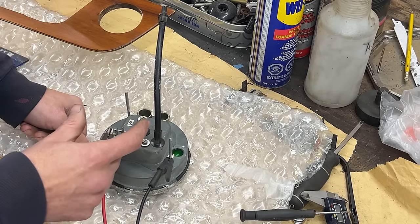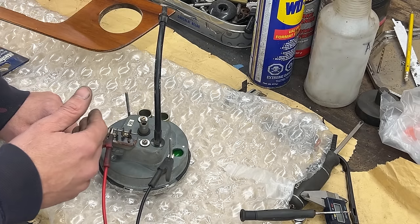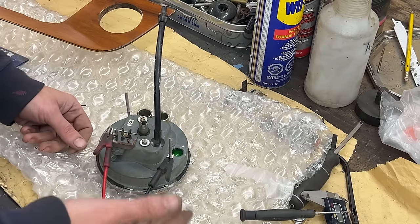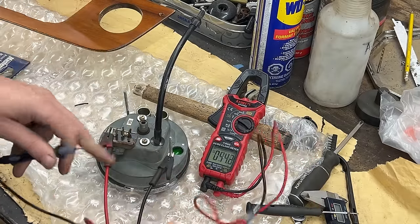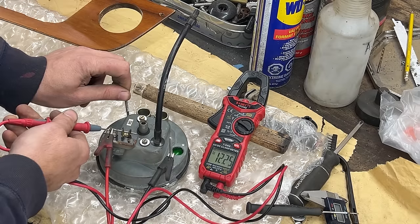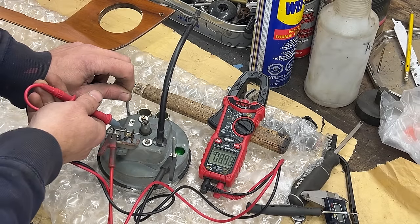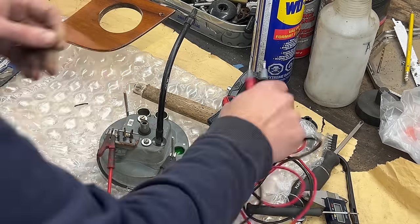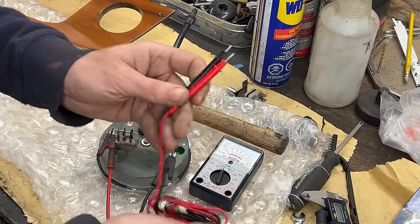The old ones have a metal strip inside that constantly opens and closes — so it either gives you full 12, 13, or 14 volts or it disconnects it, on and off all the time. The average between full voltage and zero voltage gives you 10 volts. If you try to measure that with an electronic multimeter, I have a little over 12 volts in here, but on the output it constantly varies — six, seven, eight, nine — you can't figure it out because it changes super fast. So I keep an analog multimeter, which senses voltage a little bit slower.